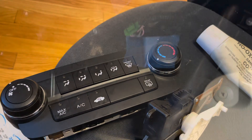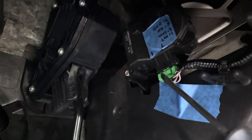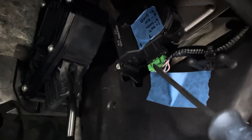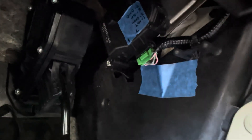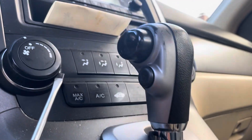What we're looking at here is the brake pedal area. You go up there and you can see this green connector and this motor that handles the blend. It's pretty easy to see and locate. You can tap this motor and pull this connector out and wiggle it around. I'm also going to show you a preparation you could apply inside on these pins for a better connection, because there's sometimes an intermittent connection in these wires that causes this problem.